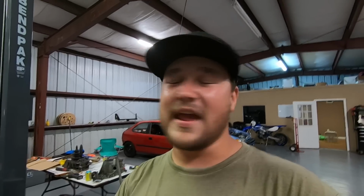All right, guys, so we just got back from the dyno, and dude, I cannot believe this thing made 600 horsepower. Yeah. It doesn't really feel that way on the street. The horsepower is a big deal, you know? And the torque, bro. 640 something foot-pounds of torque. 656 foot-pounds of torque at like 3,500 RPM. That's what's gonna make a rod come out of this block. So we're gonna dial back the timing curve a bit more. Right now, this thing's at 16 degrees of timing anywhere in boost.